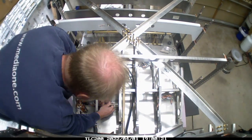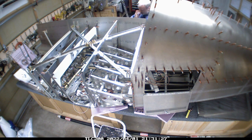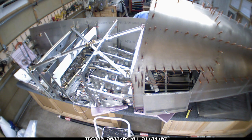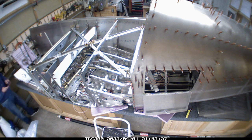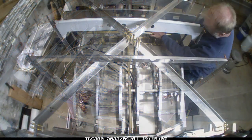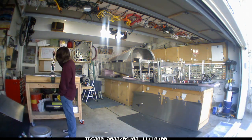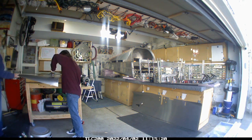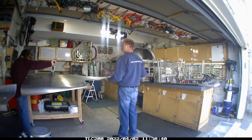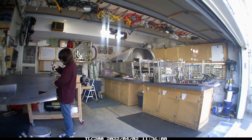Because I'm concerned about any flex in the fuselage impacting the control cables or control rods for the flaps and ailerons, I decided to get the control portion as close as I could first, and then work on getting the skins on the sides. I'm not fully attaching the skins because I plan on putting in aluminum fuel lines instead of the factory-supplied rubber ones. The factory-supplied ones have to be changed out after five years, and I'd much rather do a permanent install versus having to rerun new fuel lines in five years.